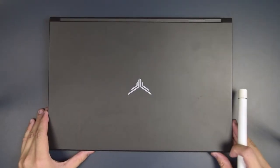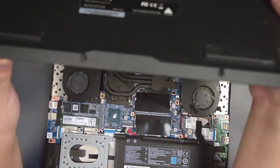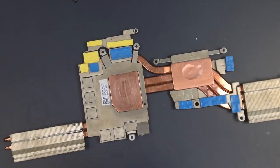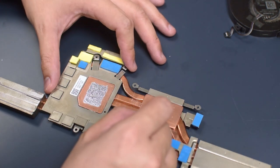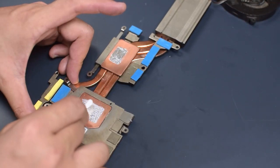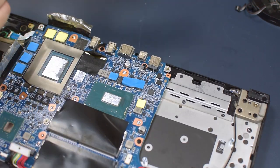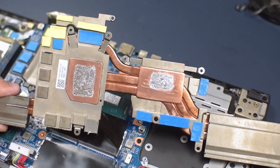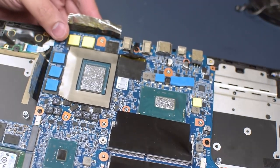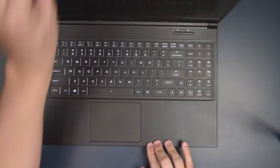It's definitely something that liquid metal can improve, so with that out of the way, it is time to overhaul the cooling. I tear my Raven apart by removing the bottom screws, then undo the screws holding the heatsink in place, and clean off the existing Cryonaut with some isopropyl alcohol. I start by applying liquid metal onto the contact area of the heat pipes first, evenly spreading it with a cotton Q-tip around the die area based on the thermal paste imprint. The same treatment is done for the i7-9750H and the RTX 2060 dies, being extra careful not to get any on the surrounding SMD chips — and this is some foreshadowing of what we will see later.